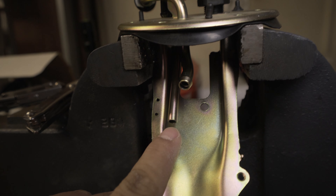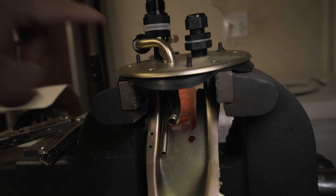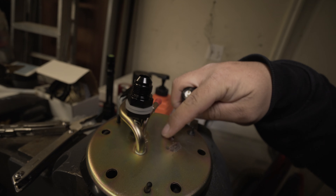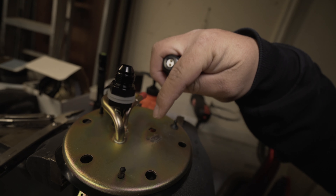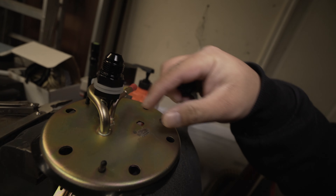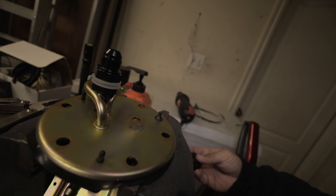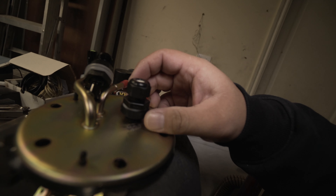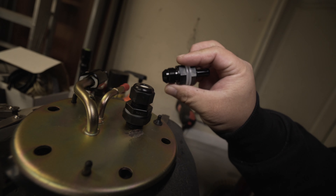Let me go over the JB Tuned upgrade and what they're doing, because it was really confusing on the website. I read it like four times and was still confused, and then I looked at their video and it made better sense. Basically in a nutshell, that's your feed and that's your return line. Your fuel pump sends fuel to the rail, it comes back, and just dumps back into your fuel tank. There used to be a wiring connection where the positive for your fuel pump went in - I basically ground that off because I'm about to drill it out to fit their plug.